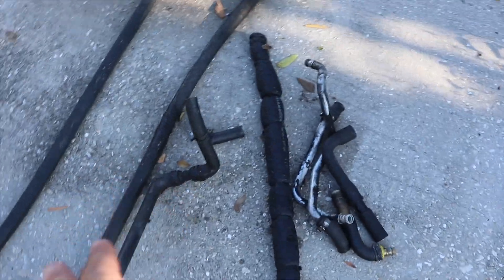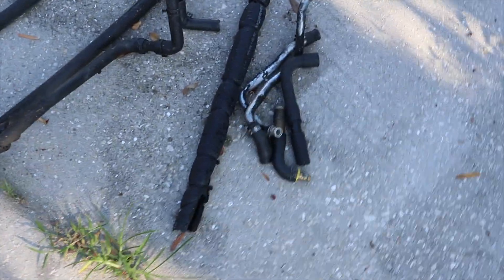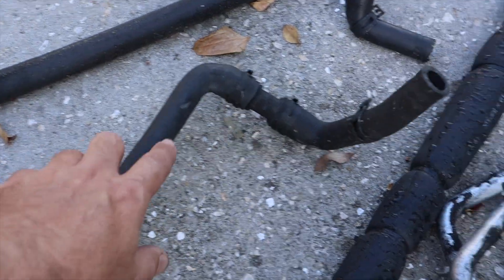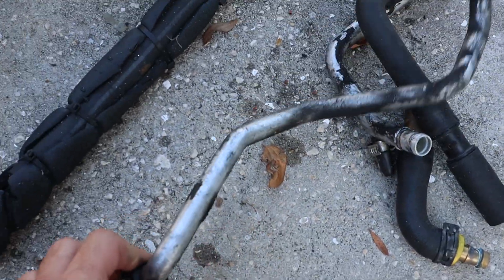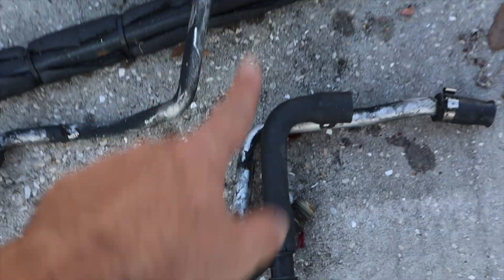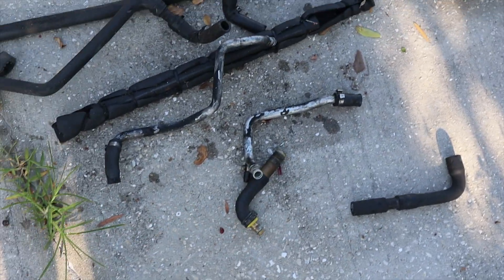So this is most of the trash I took out. I had to cut up a lot of hoses and lines just to get fittings off. Look at what we removed — all these bends that cause restriction, keep stepping down from 5/8ths and smaller. These are all the factory lines — look at all these bends. And now we're almost completely straight. There's a crap load of near-90 degree bends, straight-up 90s, just to go around frames and all that stuff.